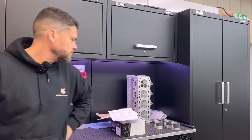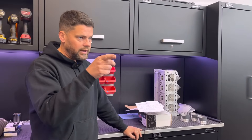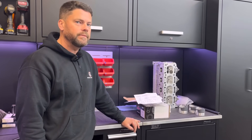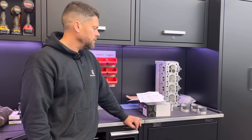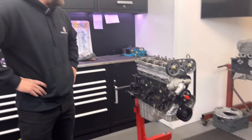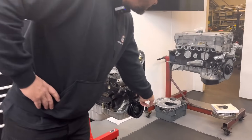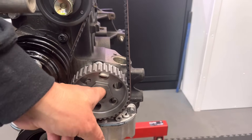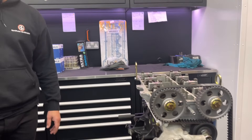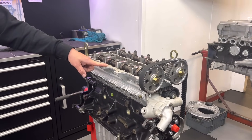Basically what we've got to do is stick it in the lathe and turn the webbing at an angle - knife-edge it. This Cosworth head here is a spare head we've gone through - all done. Next thing I'm going to do is that head today then crack on with this CBH. Yeah, got to hone a bit out of the bores, clean it up, give it a lick of paint, service the head, and get it all put together. The head's all back together, torqued up, timed up - lovely. Just yet to find a bolt and washer for the auxiliary shaft because it's a fine thread as opposed to the coarse thread on the cams. Clean all the oil galleries out, lapped the valves again, everything's good - almost all ready to go. Just got to do the rocker cover Monday. Another Cosworth out the door - have a great weekend!